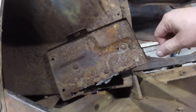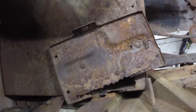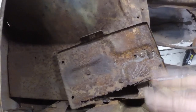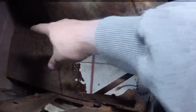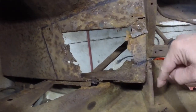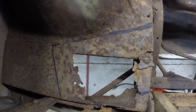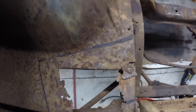This is where the battery was originally mounted in the car — you can see where the rusted-out bit meets up with this. I'm going to make a new piece of sheet metal to go in here, so I think I'm going to get the old stuff out first. I just wanted to do some measurements first by setting that back in place. After making measurements from the fender to here on the battery tray, I wrote them on the car. I'm going to repair this, get the new battery tray mounted, then take it out so I can clean everything up and get it ready to paint.